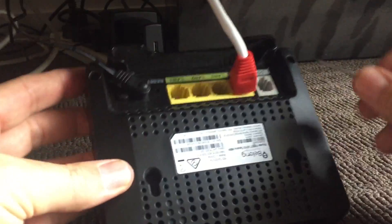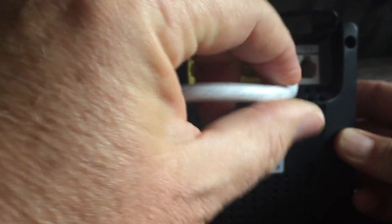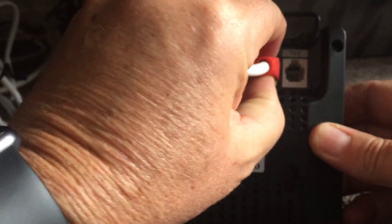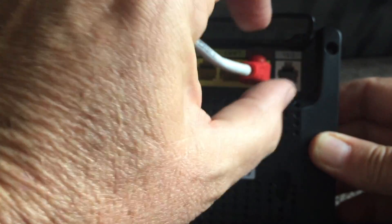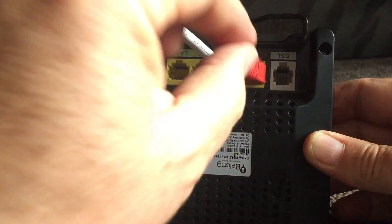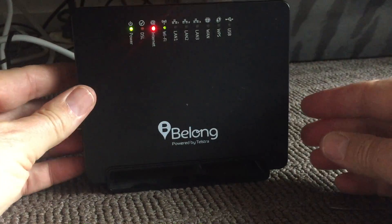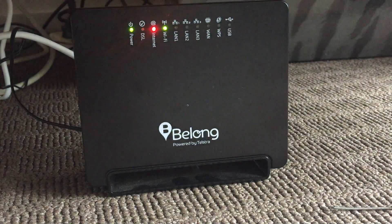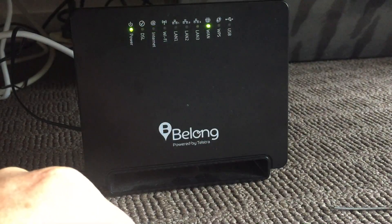It's also good to unplug the cable — don't lose track of where it's plugged in. It needs to be in the Wide Area Network port, that's W-A-N. It has a clip underneath; click that and you can pull the cable out or put it back in. You'll hear it click when it's properly in. Just pulling it in and out makes sure there's no corrosion on the connection. You can see the internet light is now red — meaning no connection — but there it goes, it's gone green again.